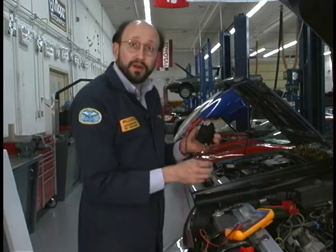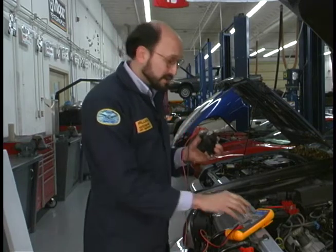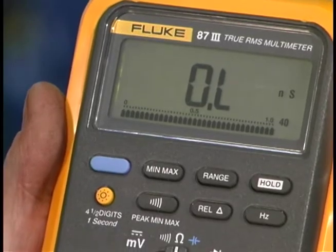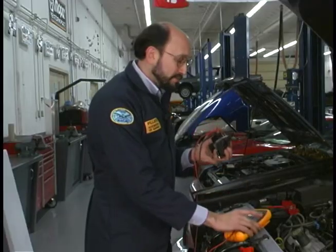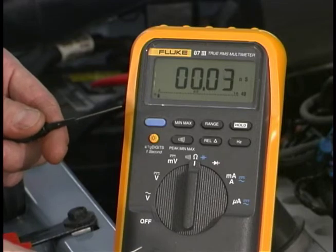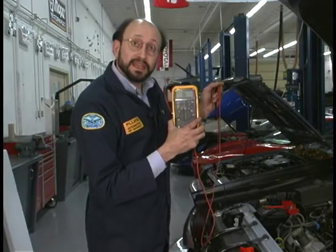Now we want to find out if there's a connection between the primary and the secondary — on these coil packs there shouldn't be. To enter nano Siemens, push the range button until NS shows on the screen. You'll note that OL is now showing. OL is a measurement that would typically show up if I move the leads apart in resistance mode. With the leads separated I have a reading, but if I short them together in nano Siemens, I get OL — again, it's the inverse of resistance.